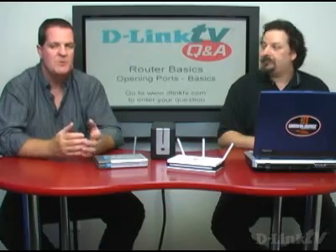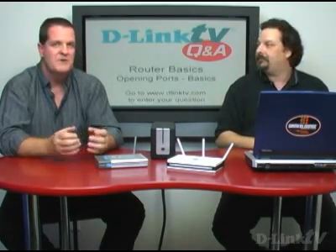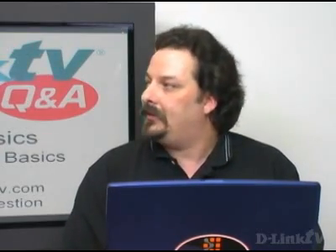Keep in mind that just because you've opened a port, it doesn't mean you've turned off your firewall or that you're vulnerable. All you've done is allow FTP access — just port 21 access — that's arriving at your router to go only to the selected NAS device. It can't get to your computers, your laptops, your gaming machines. You're telling it: open this port to that one PC, and that's it. It's a very controlled thing. You can also set up a schedule — by default you do always, but if you want, you can set it up so it's only allowed for certain times of the day. For example, if you want FTP access while you're at work, you can set it up from 8 o'clock in the morning until 6 o'clock at night. There's a lot of flexibility and power in there.